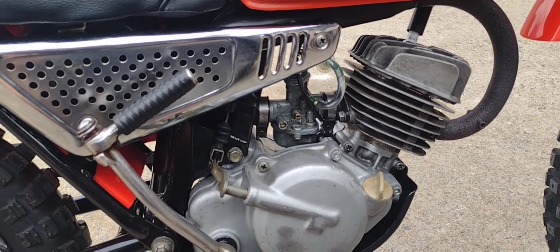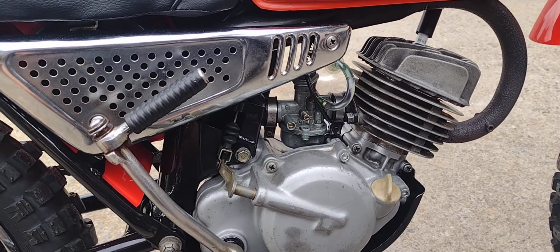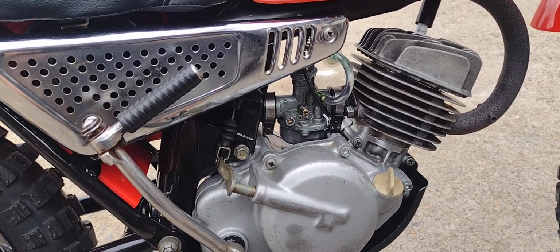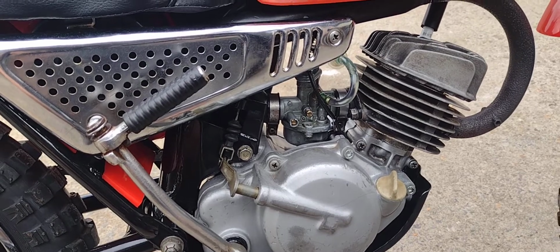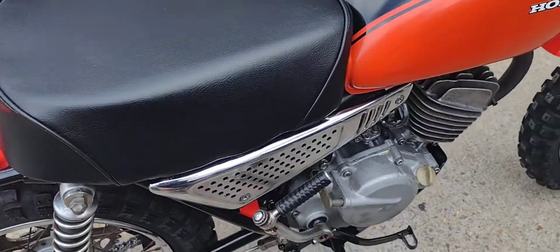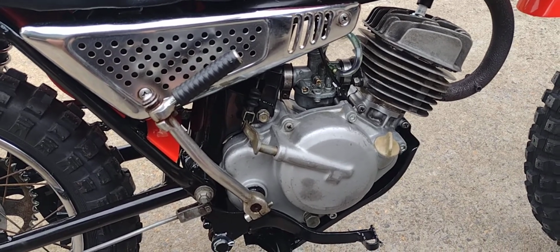I'm not going to rev it up too high. I just want to get that bottom end, that oil circulating real good. I'm not trying to fill the ports with all that oil from the bottom end. We want the oil to stay down there. But it's getting real good smoke. Got the 927 castor mixed 32 to 1, 93 octane.